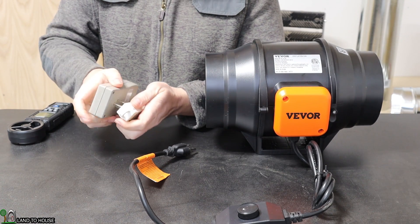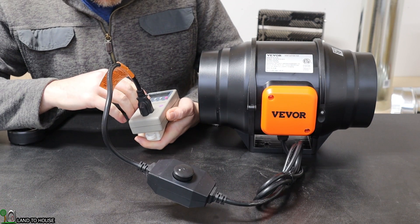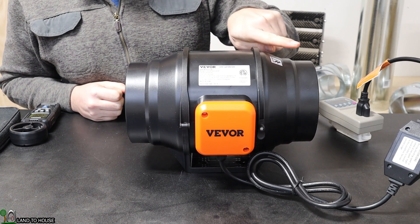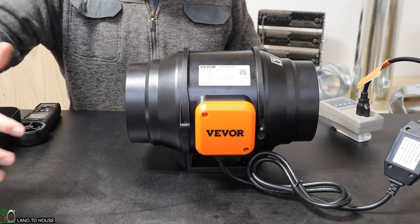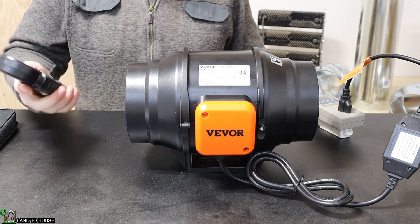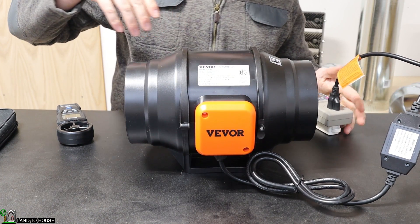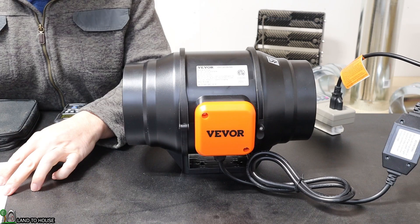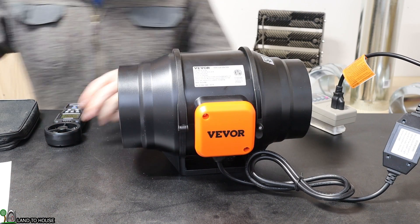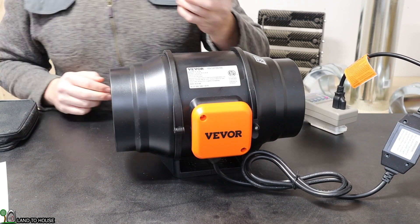To start this test, let's get our watt value. I'm going to plug up my meter and get it hooked up to power. I'll scroll up to the watts setting — this thing actually consumes 0.6 watts whenever it's turned off. The direction of airflow is this way and we're putting our components on this side. I've got the watt meter and the anemometer set up. Let's get the control value — I'll turn this to the highest setting. The watt reading is 74.3 and the wind speed is 24.3.